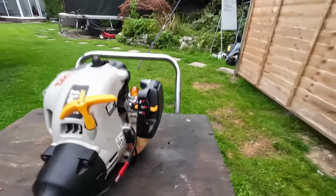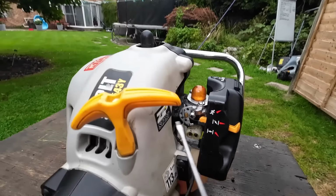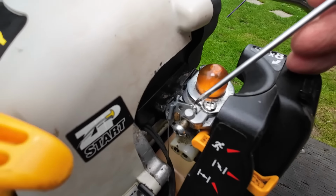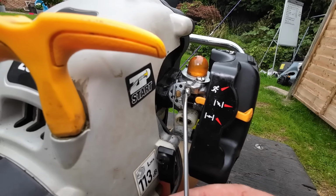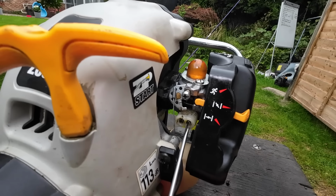So all I've done is, initially, to keep the machine running, this is your tick over screw, okay? Just this one here. Now that one, all that does, is that screw there, it goes in against the butterfly, and it just forces the butterfly open a touch, so it will idle. What you want to do eventually is screw this in so that the machine will idle, and then tune it, gun the throttle, and then tune this one left or right, normally leaner,